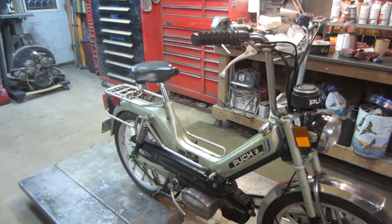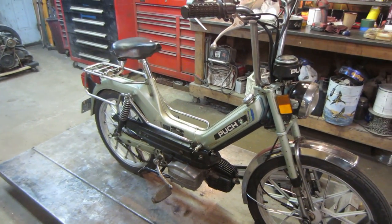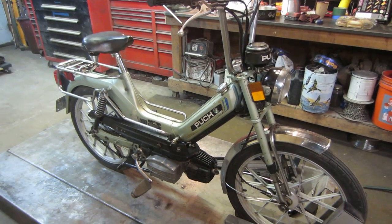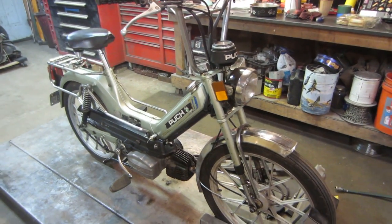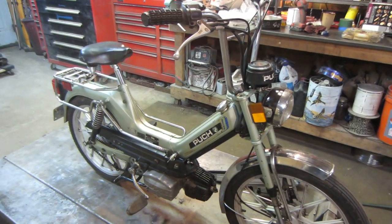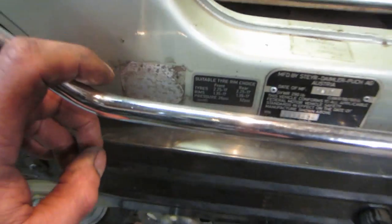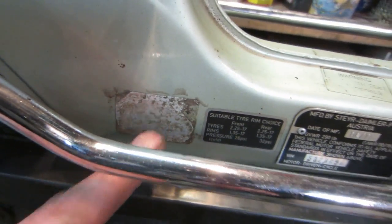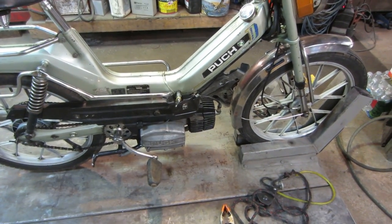The speeds go by. Certain towns had different levels, and it was a 20 mile an hour speed limit. Some had 25, some had 30. So it all depends on where the moped was sold, how it was set up for. As far as this machine was concerned, it was a one horse, a one and a half horse, or two horse. I believe this was set up for a one and a half, which was set to do 25. The stickers wore off, but judging by the carburetor that was on and the intake, it was the smaller setup, which would have made for a restriction.